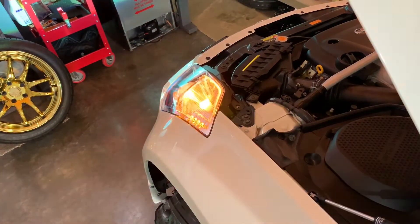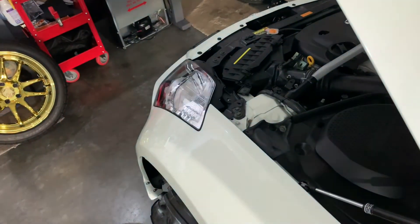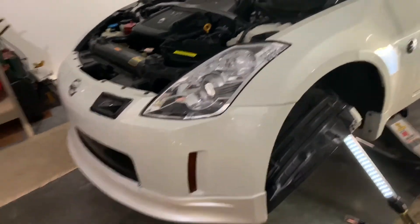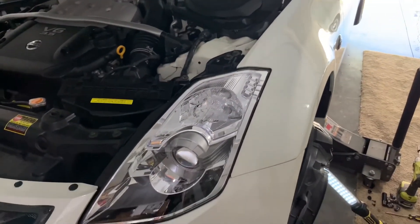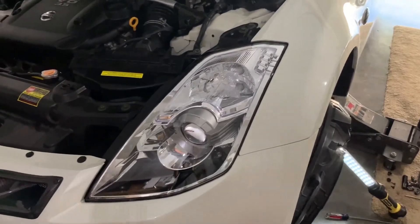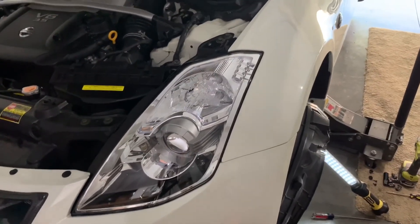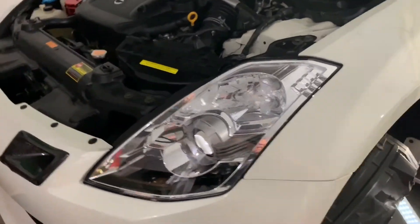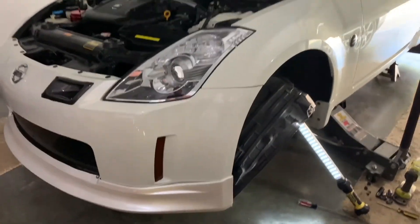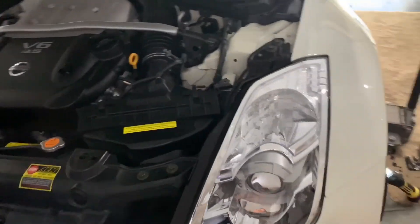Lights off, parking lights on, headlights on, turn signal — parking lights off. All you gotta do is make sure those prongs are covered up, put it back in, and you're good to go. You don't have to worry about the hyper flash or the light coming on when you turn your headlights on. If you know of any other ways to have the light on with your lights and also not have hyper flash, let me know — these bulbs have built-in resistors so there's something else going on with the three-wire setup. Hopefully this helps somebody out — leave a like if it did, and I'll see you next time.